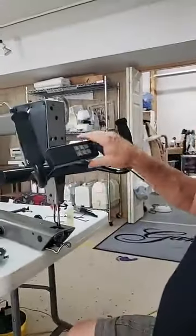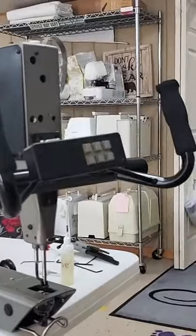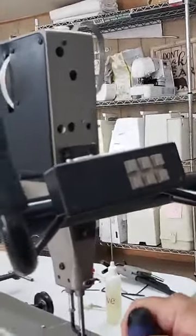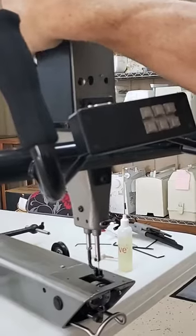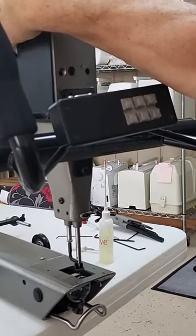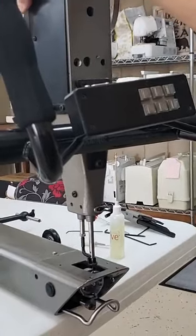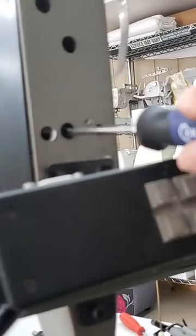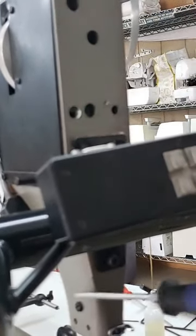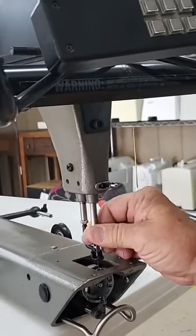So, this is an old Statler retrofit, and I've taken the keypad out of the way so that I can access the clamping screw that holds that needle bar. If the needle's all the way down, you can access that screw. If the needle's up, the screw's gone. So it's kind of a reminder, hey, wait a minute, that needle has to be down to its lowest point to even be able to access that screw. Take your time, wiggle it a little bit till you're absolutely sure you're at its lowest point. At that time, you can take your screwdriver and stick it in there, and you're going to loosen that clamp just a little bit. Do not unscrew that screw, or you're going to be taking this panel off and fishing it out of the bottom down here. You're just going to loosen it, which will allow your needle bar to turn and move up and down.